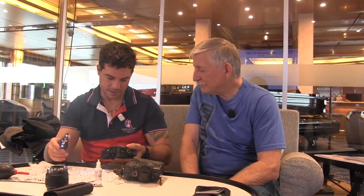That hair actually came off just from blowing it out. Depending on the sensor — this camera I haven't used a whole lot, so this sensor should be pretty clean. There's like one little spec on there; let me see if I can just blow it off. Less is more in this case — if you can avoid brushing it, there's less chance of scratching the sensor. Overall this sensor is really clean. I'm not going to brush it just to brush it.